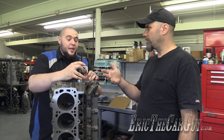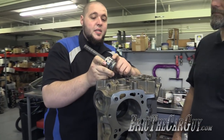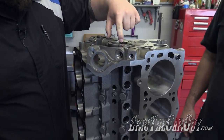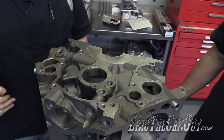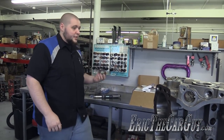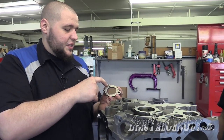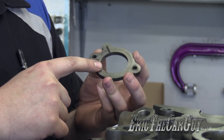Is this one you have to mark like the other ones? Yeah, this one especially has two slots — the main slot and the side slot. We also have two holes in the block: the main oil feed and one to the side. That one to the side feeds the front plate. This is your thrust plate — that little oil feed just feeds this slot to give oil to the thrust plate so that doesn't wear out.